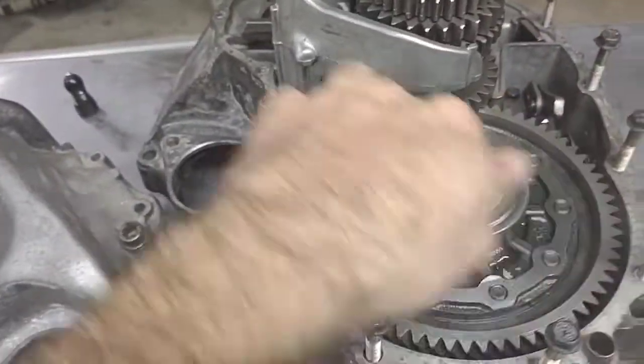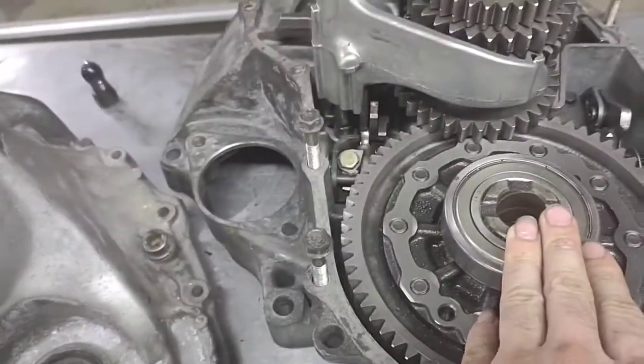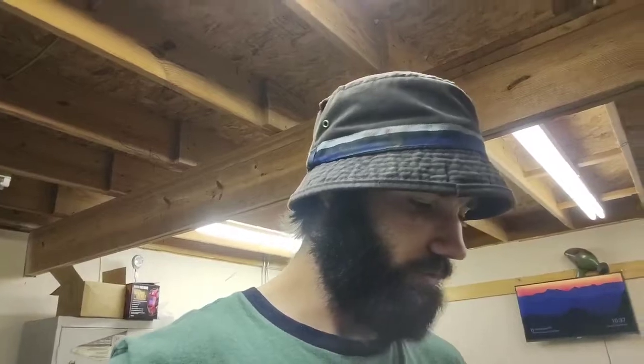Just cut out a piece of plate, pretty much. Thought I had some, this is a little bit too thin, but get some plate, throw it on the bottom of the spider gears, cut it out in a square, and just weld it like you would normally weld a diff for a drift car, and run it like that. I know I said let me know what you guys think, but I honestly think that, it being my car and it not being for somebody else, I'm comfortable with it. I think that's what we're going to do in the next video.